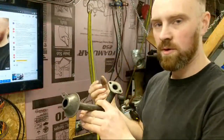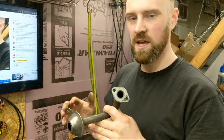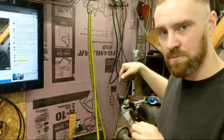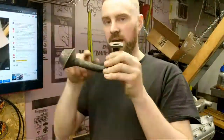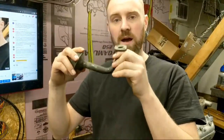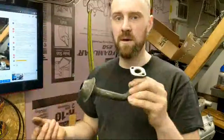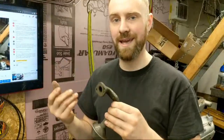There is a problem that's been known for a while now where some vehicles in particular, I don't know which ones, don't have very good bracing for this sump that is usually pretty long. Now this motor, it's not, because the GTO has the pickup on the front of the pan, and because of that, it's got a short pickup. But when they have that long pickup, they're not braced very well, and being it only has one, sometimes bouncing around when you're just driving normally, it'll fatigue the metal and it'll start to come down, and then that O-ring will drop because the pump is not designed to pump air. So it's a very common known problem, and there's a fix for it.